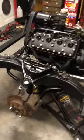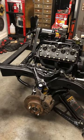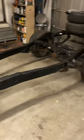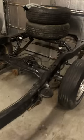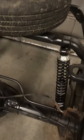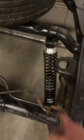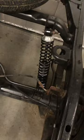This is a chassis from a 2002 Dodge Durango. My last build, a '42 cab-over, used a 2002 Dodge Dakota. This is a Durango chassis. I haven't done much to it except replace the shocks — they were really bad. I put on these coil-over shocks just to help give it a little stability.